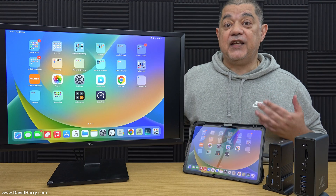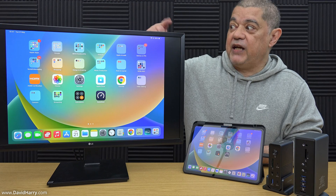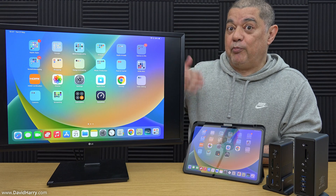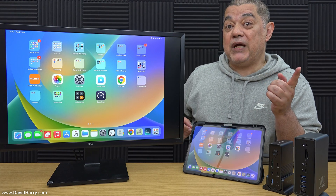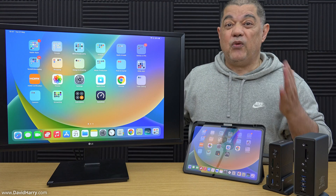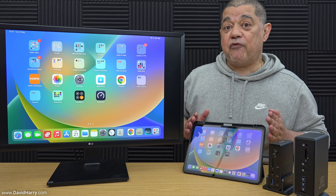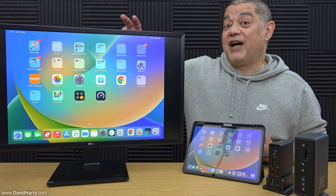As we can see, this is basic screen mirroring. Because of that, we get black bars on the sides of the picture — a black bar on this side and a black bar on that side. Technically these are called pillar boxes, which are the opposite of letter boxes — letterboxing is where you get black bars top and bottom, pillarboxing is where you get black bars down the sides. The reason we get that is because TVs are 16:9, a wider aspect ratio than the iPad, so the iPad's aspect ratio gets centered into the 16:9 frame of the TV or monitor.